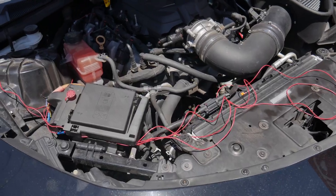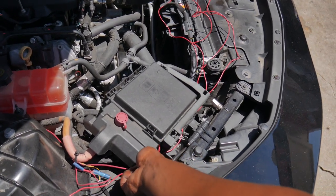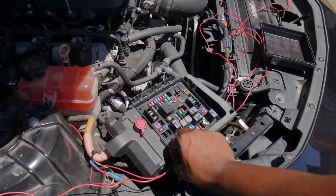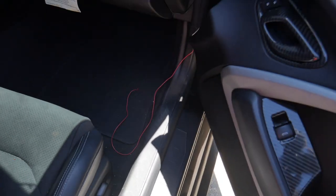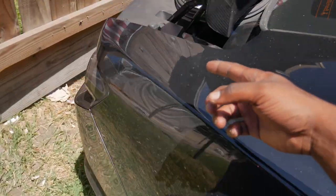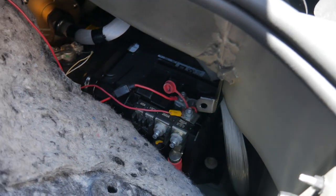First, we got to disconnect the battery. Then we can start messing with the wires and figure out how to run them, because J.I. — you already know it's got to be OEM-plus, got to be clean. So as y'all can see, the hood is open right now. This is the current positive wire for my P3 gauge and my AEM wideband — they are wired up to these two fuses. I've already kind of ran this power wire through the fender and got it running inside of the car. I'm going to pull it all the way through, tuck it inside the plastic with the carpet, pass it through, and come back to the battery. We've got the two positive wires for both of the boxes right here — we're going to disconnect them, splice them together, and splice them with that wire. We should be good to go.